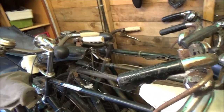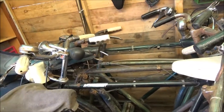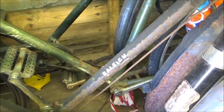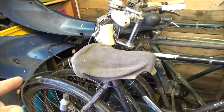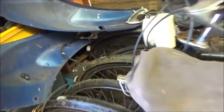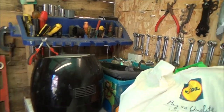Under that is my Rally — the frame is a smidge taller, or it could be because they're leaning, I'm not sure. I picked it up with a job lot of bikes. It's got 'Rally' written on the frame. I don't know how old it is. I've dismantled the rear wheel — it had a dyno hub but the gears were shot, so I've just stuck a three-speed wheel in it to move it around. The spokes and parts are in that blue tub up there, along with the wheel rim.